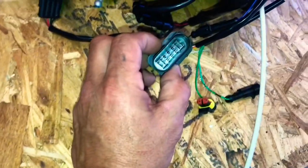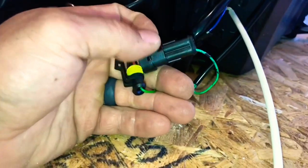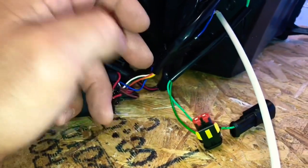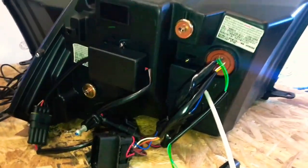I got projectors, so I'll be plugging this into the pink plug on the truck. That goes into that. These green wires come plugged in — if they're plugged in you get basic turn signals like before. If you unplug them, it's sequential. So I'm leaving those unplugged because I want sequential turn signals, which would be pretty cool. Anything else stays unplugged, and that's it. Let's install it.